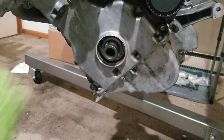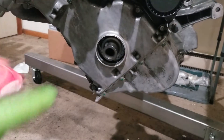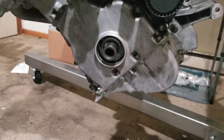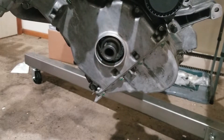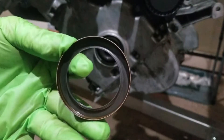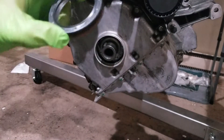Tonight I'm installing the front and rear main seal. I'm installing these Cortecco, or CFW as it might be known as well, crankshaft seals. These are a PTFE seal. As you can see, there's no support ring behind there, and these need to be installed in a very specific way.